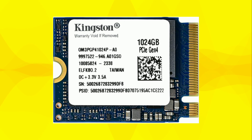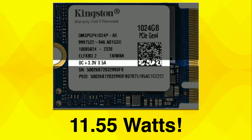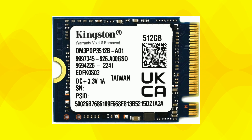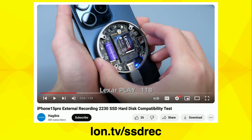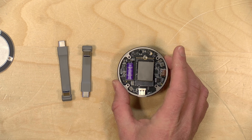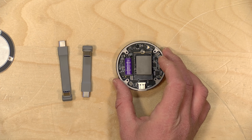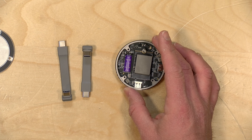I was surprised by how few drives advertise their power consumption, but also how many go well beyond the four and a half watts supported. For example, this Kingston drive I found on Amazon draws 11 and a half watts on its peak power draw. I found another Kingston drive, a smaller capacity one, that does fall within the spec — it draws just 3.3 watts. The manufacturer also did a video looking at compatible drives, which helped me decide. I went with a Lexar drive that, even though it doesn't advertise power consumption, appears to be working fairly well inside the enclosure. If it does have a power issue, the capacitor will keep the drive on long enough for its cache to clear and everything to get written back to disk, but that's no guarantee. So choosing the right drive is really important.